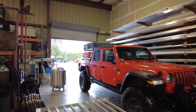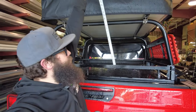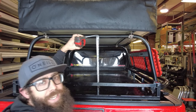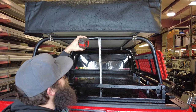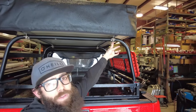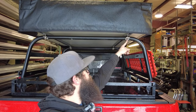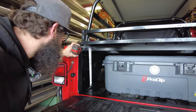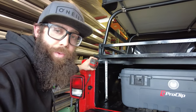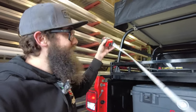This camera is pretty cool — I'll tell you guys about it later, but check this out: I'm just walking over here and the camera turns and faces me. Back here off the deck, we have about 18 and a half inches overall to the bottom of the tube — it's more like 18 to the bottom of these bolts. I'm going to end up cutting the excess off, they don't need to be this long. So we can store 18 inches of whatever up here. On the high side of the ridge underneath the bed, it's about 15 and three quarters of an inch of usable storage, and 18 on the top.